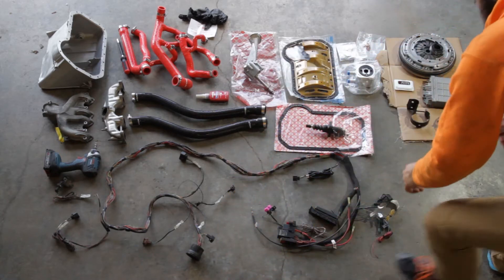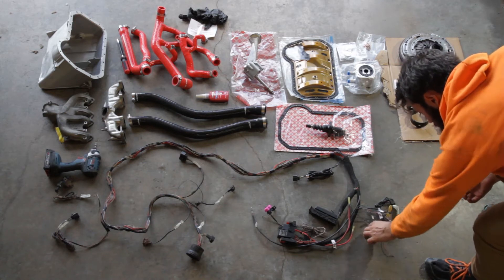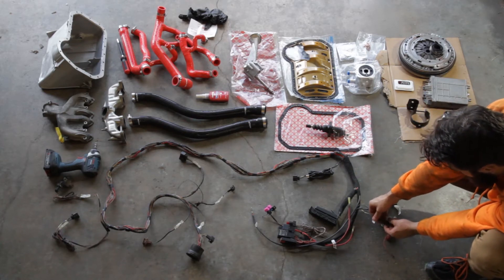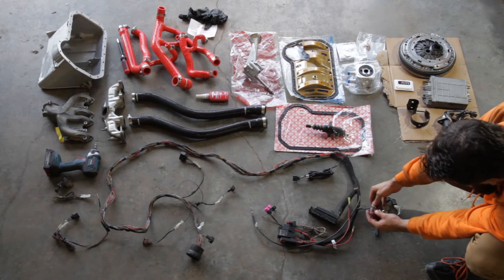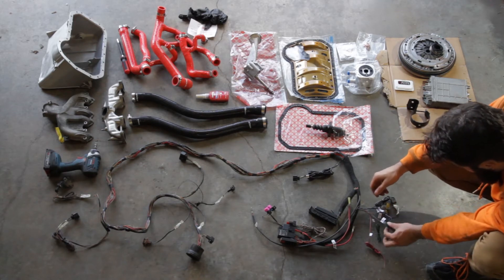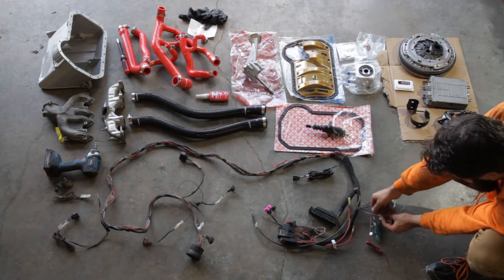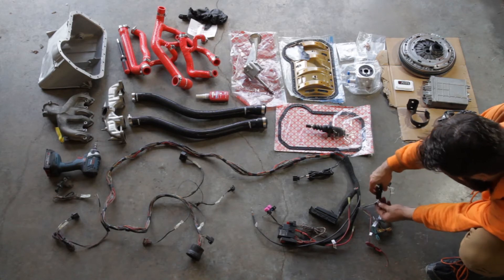The rest of these are like temperature. You have your tach right there, which the tach requires — you'll get information with this once you get the harness — but the tach requires a booster to run with the original, maybe. I'll figure that out. Trigger, probably 12-volt. This is glow plug light, which I don't have a diesel van dash, so we'll probably have to see what we're going to wire that into, maybe just an indicator. Temp gauge, and then oil pressure light, that will just go to the normal oil pressure light.